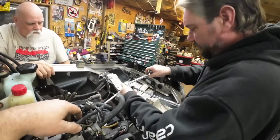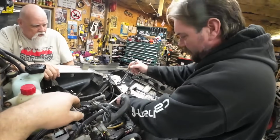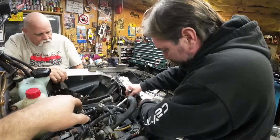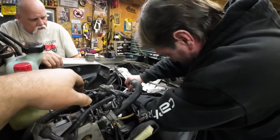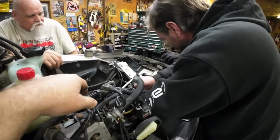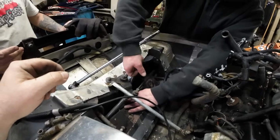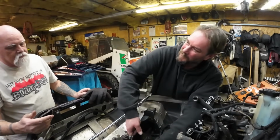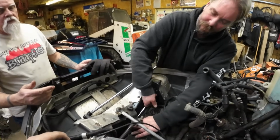These bulkhead radius rod bolts are a pain in the butt. You broke her with the breaker bar, Brad? Oh yeah. All right. No torch action tonight, then, I guess. Is that long enough? No. Now you got to find the exact length of socket and extension combination. The ratchet wrench. Because I couldn't get a socket underneath of it at the beginning. So once it cracked loose, there was enough room to get a ratchet wrench on. Okay.